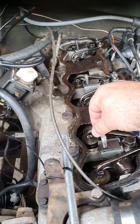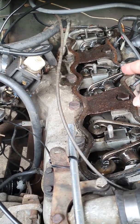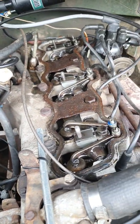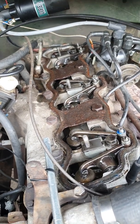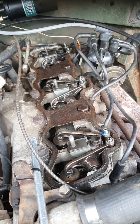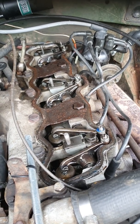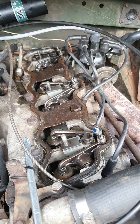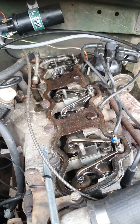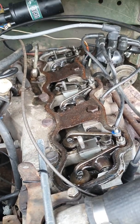The one thing I'd advise: when you're setting these rockers, always check when they're free for lateral movement, because that's an indication of wear and you don't want that. The valve stem seals wear, and then those rockers can move sideways — that's like a warning. If they're nice and firm when they're up, then it's okay. I've done that already and I'm happy to say that for now this is okay.